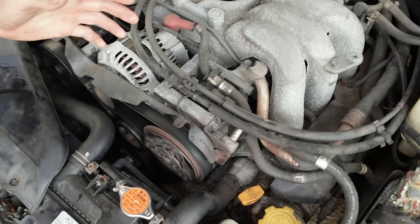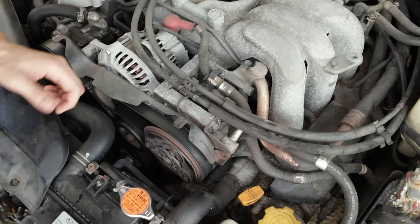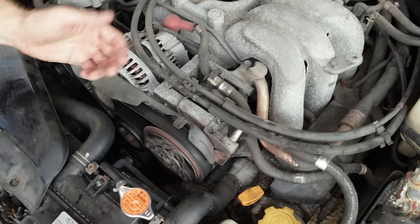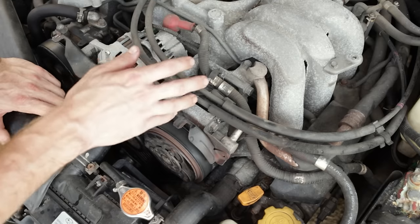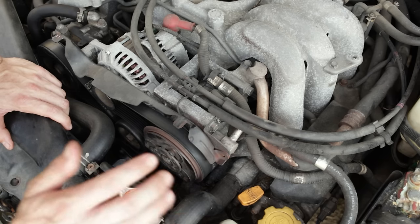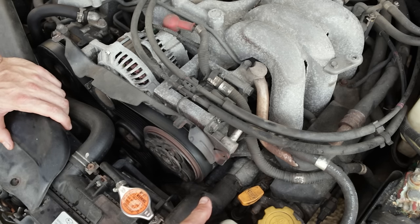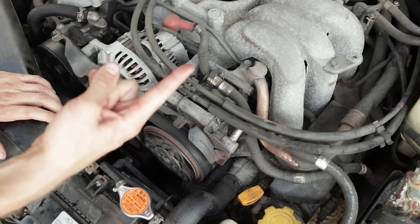My 2004 Aspen White WRX — that was the issue why the AC didn't work: those O-rings. My 95 Legacy L, AC system was perfect for about five years. When I did the videos last year getting it back up and going — replacing the clutch, etc. — AC issues came that summer. Again, these two O-rings. I've seen this time and time again; if your AC stops working, that's where I advise people to start. Also always check your AC Schrader valve cores. It's cheap insurance to replace them while you're replacing the O-rings.